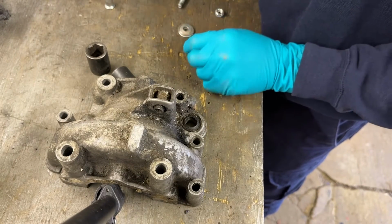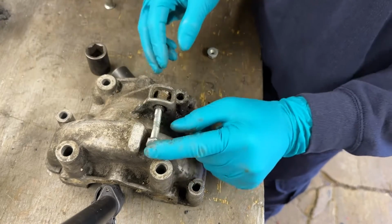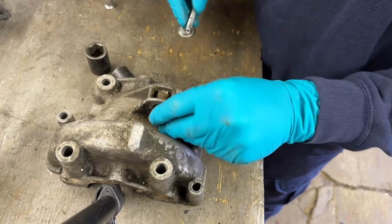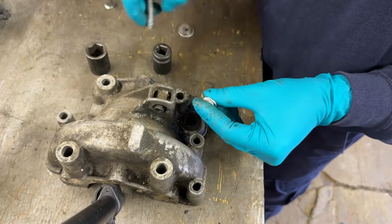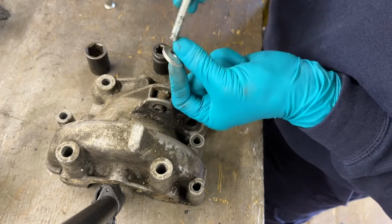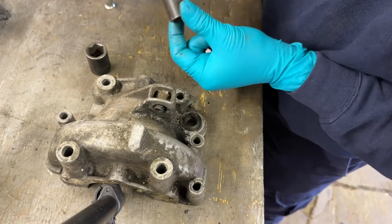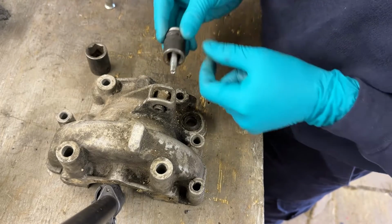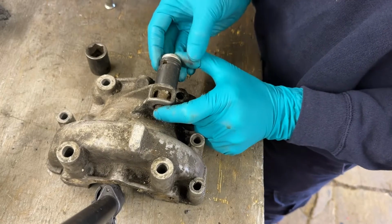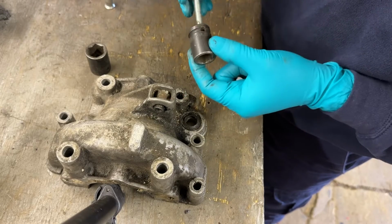It's a fiddly one. What we're going to do is, to do pulling, you want the bolt head on this side, and we can't do that, so we've kind of got to assemble it together the other way. So I'm going to do a pair of big washers. These are just penny washers, M8 penny washers. This is a 17 mil socket. You could put a 16 mil on there, but you are very much clutching at the straws of what will reach. Why is it not reaching on there?